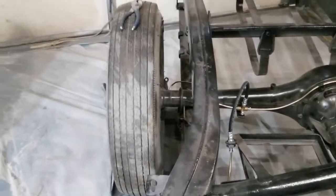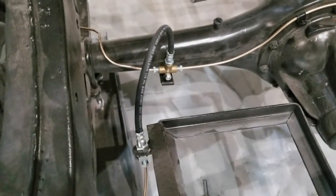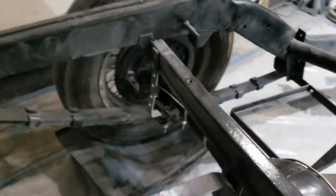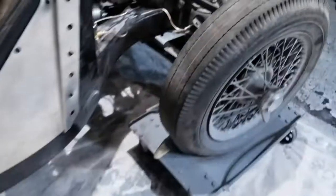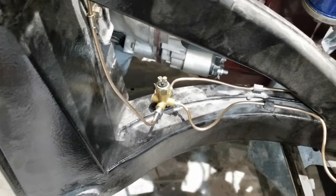All right, so I might as well make an update video. I'm waiting on one of my pipes here. As you can see, it's just a little bit too short by a couple of inches. Actually, it'll be more once it's routed correctly on the chassis. But I've got all of the stuff otherwise routed: the flexible hose, the tie downs, etc. I'm not too awfully displeased at how things have gone, but I'm at a standstill until I can get more pipe. I've ordered more pipe off of Amazon, and I'll just bend it and flare it as I need to. I've got the four-way ready to go. All I need is that one long pipe, and I'll finish out the routing of everything. Got that put up, over, around, and just sitting there.